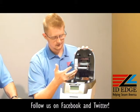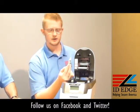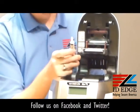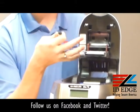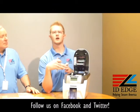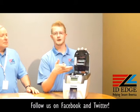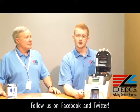For simple maintenance of the print head, you'll use the cleaning pen. All it is is an alcohol-saturated pen — you pull the cap off, the tip is exposed, and you just run it right across the tip of the print head. Give that a couple minutes to dry. The print head uses thermal heat to melt all the color onto the card — that's how it combines all the colors. If you don't let it air dry and there is alcohol left on the card, it will catch fire. Other than that, the maintenance is really easy and super low maintenance.